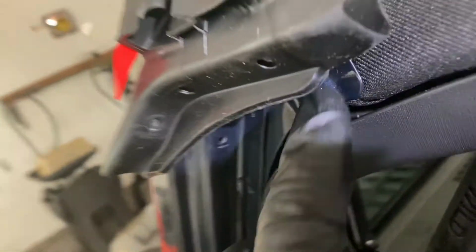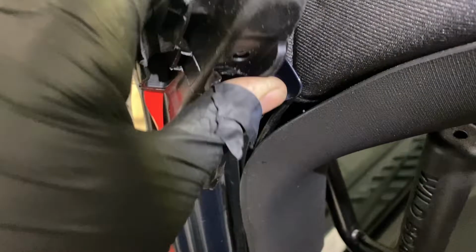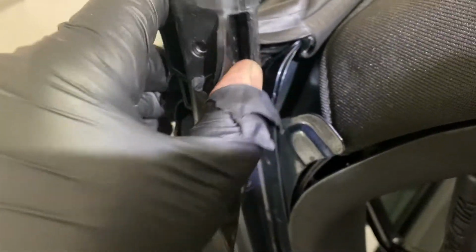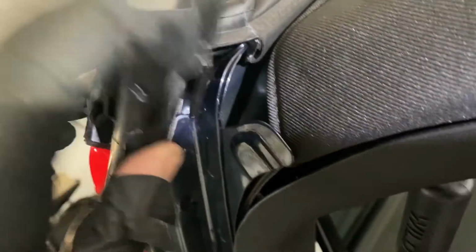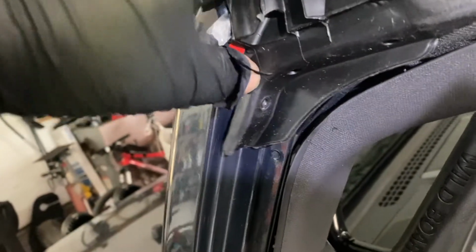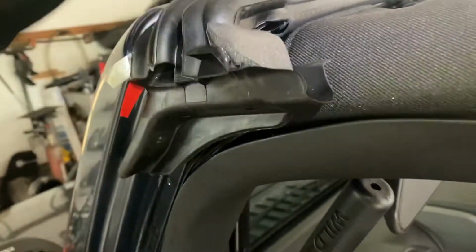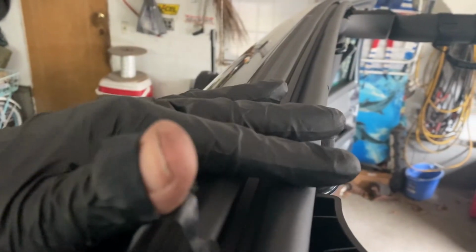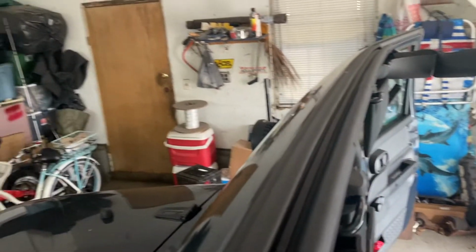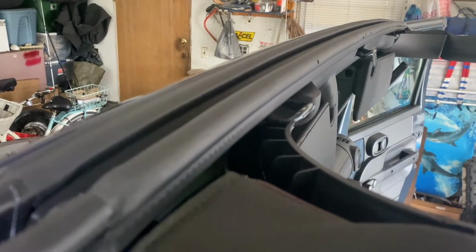And then you see over here, it has to go, it's like a little slot right here that has to go right here. And it just slides in like that. And once I put the butyl on there, I'll put the pop rivet there and do the same thing on the other side, and you're done. Nice, it's a little bit above, has a nice fresh seal, and I won't get any air. It was severe wind noise coming from the top.